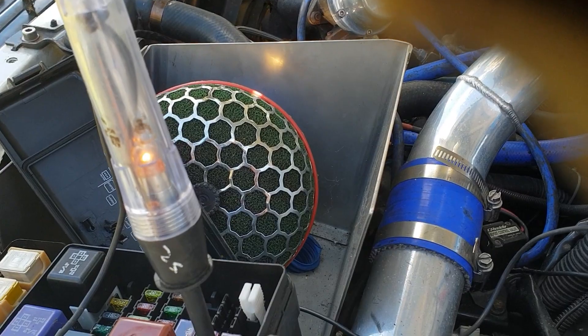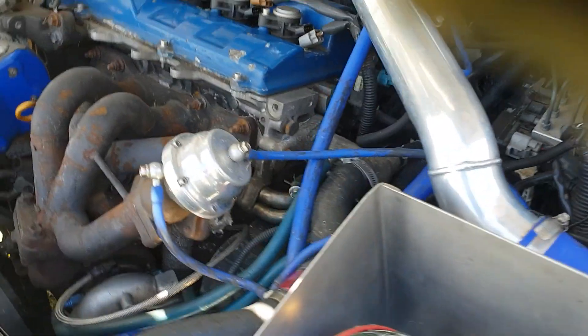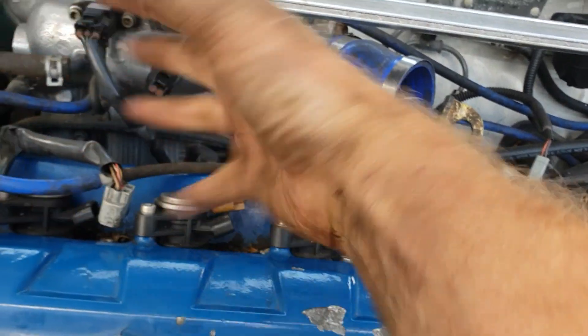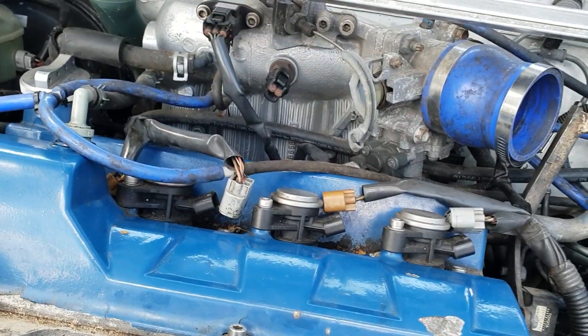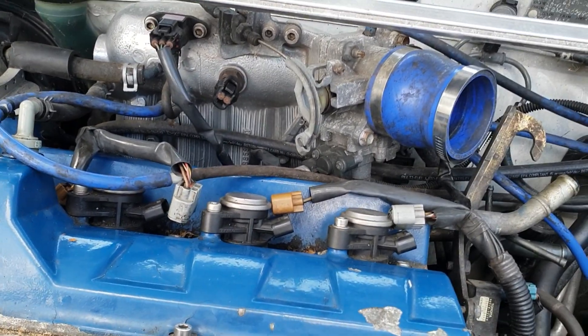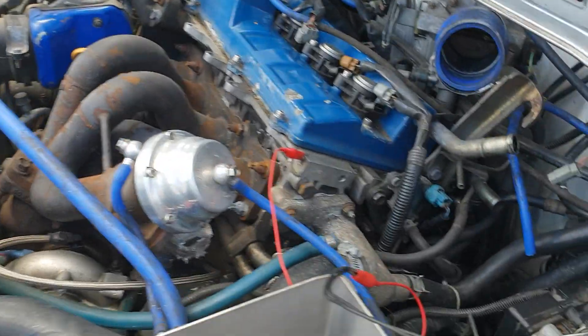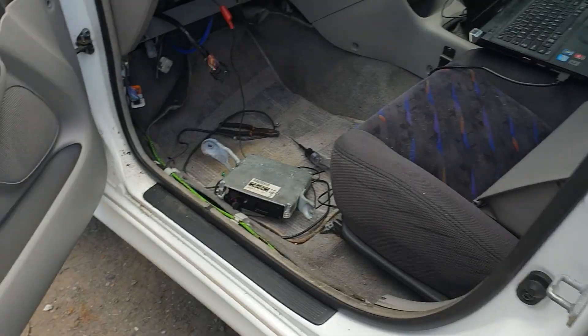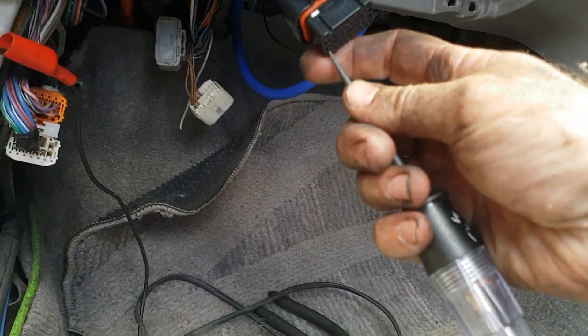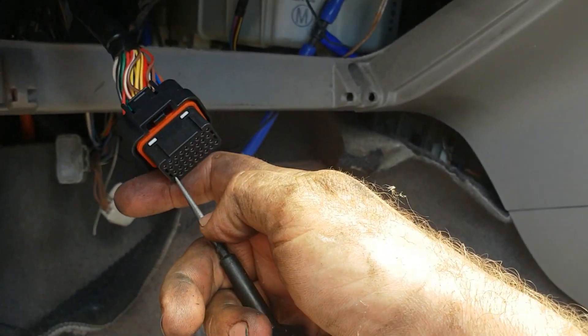You can see there's a bit of a glow through that circuit. Working our way under here, I squeezed my hand in and found where the earth was bolted onto the bottom of the intake manifold. I gave it a wiggle — it wasn't loose as such — but I found these black wires. Suddenly I had an earth at the main EFI relay. Coming inside and plugging the relay in, I now have voltage. I'll check the earths as well — I still don't have earths on those two cabin wires, but I'm on the right track.